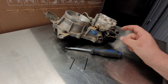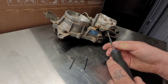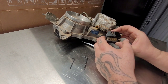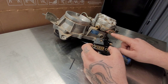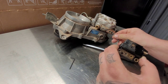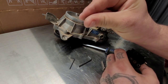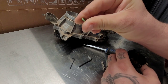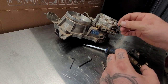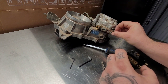Next, what I had to do was take off my EHA valve, which is this guy right here. You're just going to need a flat head to pop this off. Now that you have that off, you're going to start messing with this guy right here. There are two tiny little green O-ring washers that are right here. What you want to do when you take this thing off is make sure that these aren't crusty, worn, ripped, or torn. Usually just replace them, but these actually were replaced — this is a fuel distributor that we've been messing with and rebuilding. Just make sure they're still nice and rubbery so they have a good seal and aren't cracking.